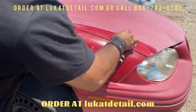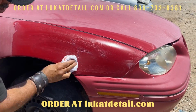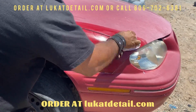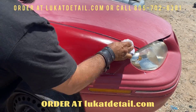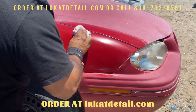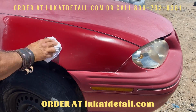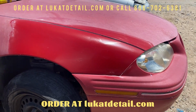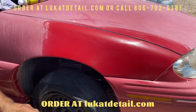Now remember, technically we're not detailing because we're not putting a shine on. All we're doing is cleaning the paint. The shine's already there. It's just buried. Most of the time you'll notice that the hood, roof, and trunk look nasty, but the sides look good. Well, just as good as the sides look is how good the top looks when it's cleaned up. Now, if it's peeling and delaminating and stuff, I got videos where you can watch it. That's actually destroyed paint, but you can still clean them up and bring them back to a point.